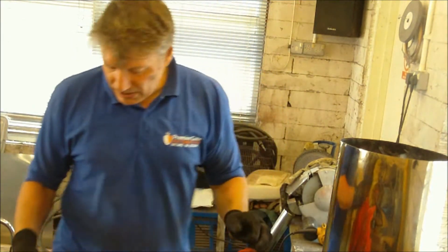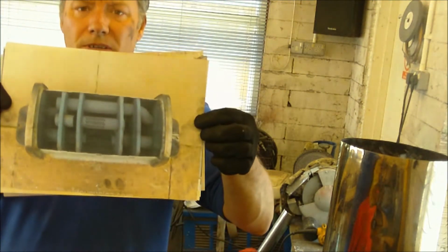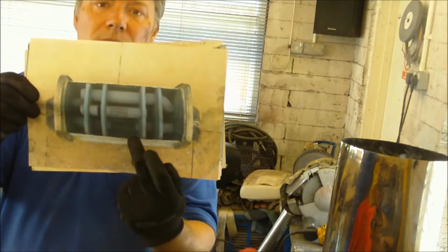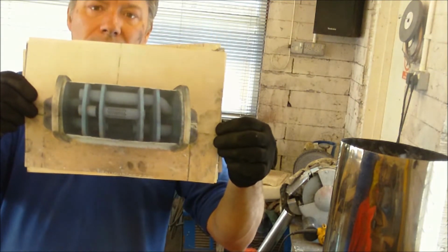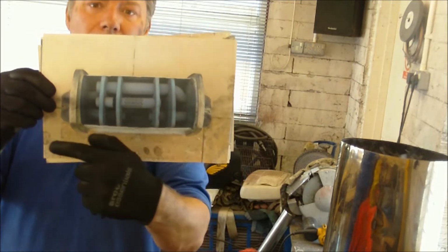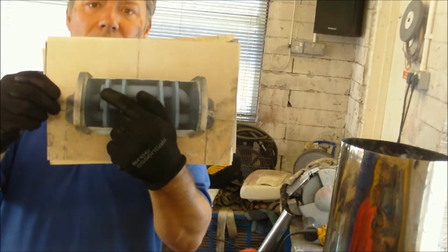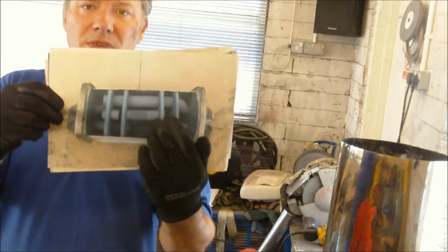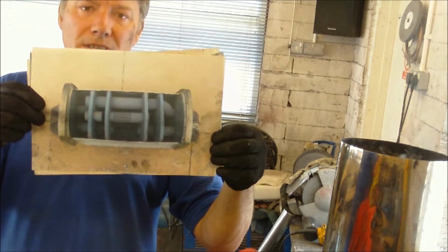There's quite a lot involved in these Ferrari exhausts, because the centre bank, or the centre chamber, is completely open to both exhausts. They mix up in there and then they divert, going that way or that way, to the next chamber, then to the next chamber, then through another pipe they go straight across and out. So once they've mixed in here, they never get mixed again, and then they exit independently.